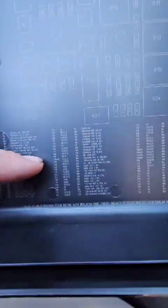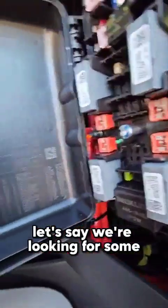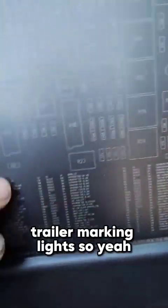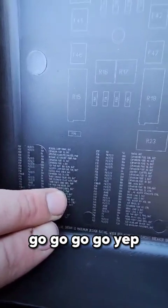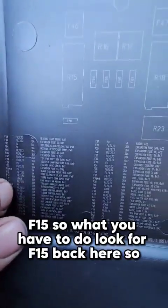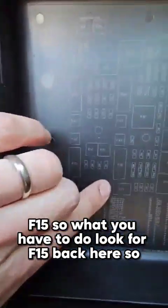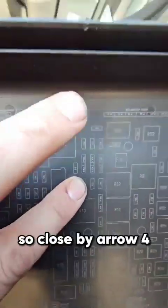You're gonna see all the fuses and what they're doing listed here. Let's say we're looking for trailer marking lights — start with the first section. As I see, it's a 20 amp, F15. So you have to look for F15, and I found it back here.